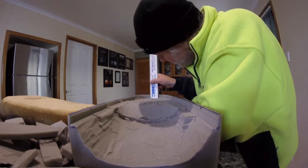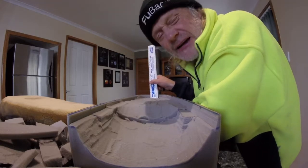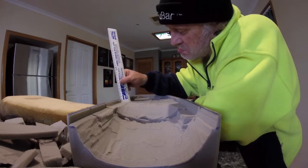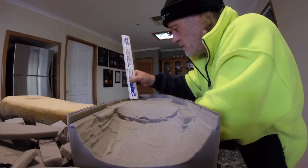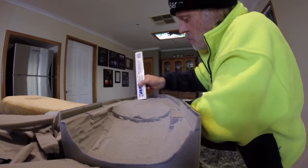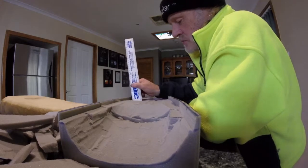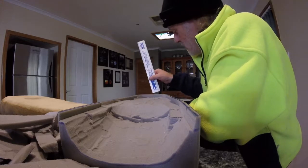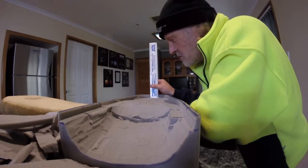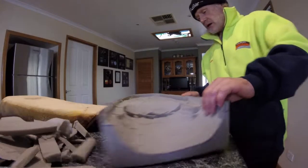But if I push that down, that's about 18 mil. We said 15. If I come up to here, it's about 10 mil. So it's a little bit deeper there. So I can pull most of this out with the flat disc. And even if I end up with, say, 20 mil of a lip there, it doesn't matter, because once I pull it down over the pan, I can trim it off. So all good.